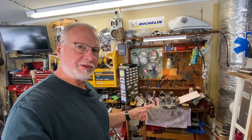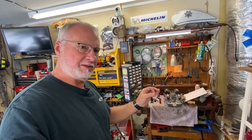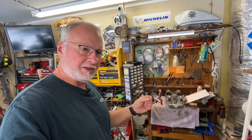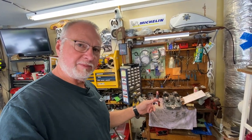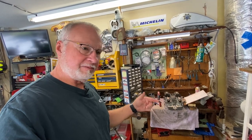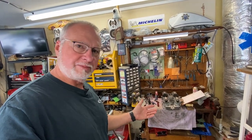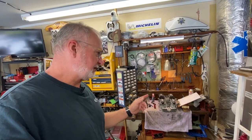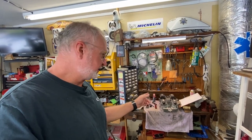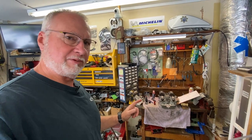I always convert over to imperial — it's just easier for my brain. I don't use the charts in the manuals because going up a column and over a row just doesn't work for me; you end up with a shim that's a little too big or too small. So I do the conversion math and figure out if I need a 2.20, 2.15, or 2.25mm shim for a particular cylinder, order those shims, and then dial it in. It's never failed me. I also need to order the proper shim-over-bucket clamping tool for the KZ1000 to do shim changes in situ — I don't have one and I want one.